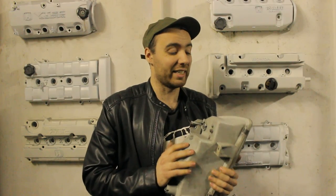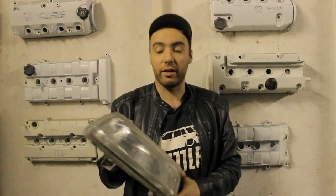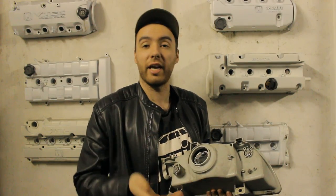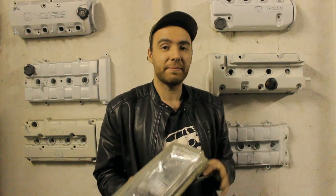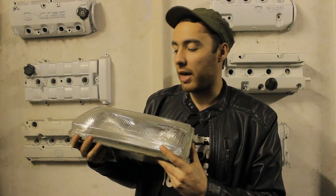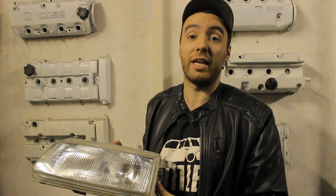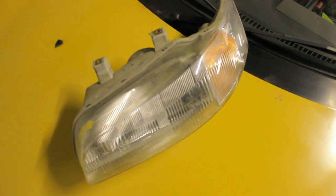Finally, the most difficult to rebuild: classic 80s and 90s Japanese headlights, like this Honda Civic headlight. Looking inside, you can see it does have a bulb cover, but the bulb cover has no indicator for the beam — no different sides that shield part of the beam. Instead, it's done by all the edges and creases inside the glass, making it really hard to modify. The proper way is to cut out the edges from the glass, which is next to impossible. Can you guess which type of headlight the Honda Beat has? Yes, it's the third one.